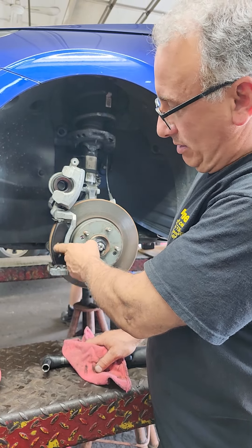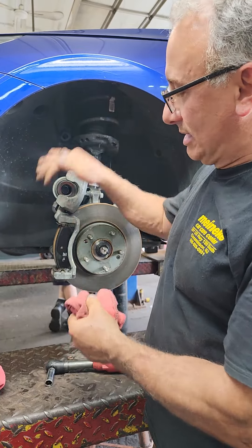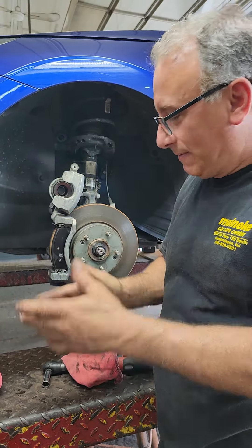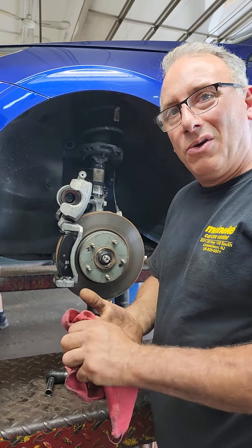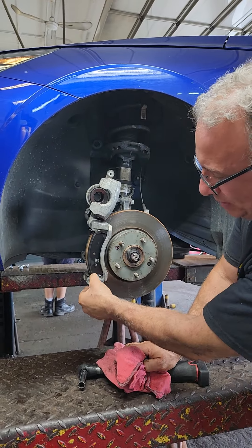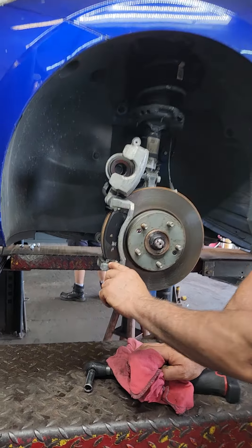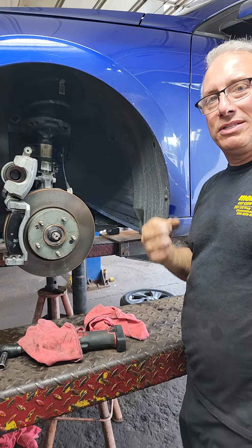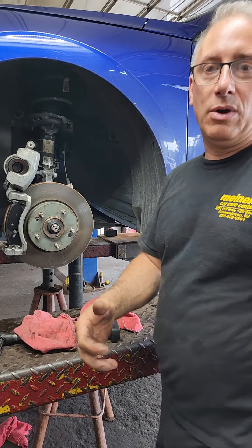What we're going to do is brake-clean all the lubricant off the caliper, then take black RTV and put it on both sides. Set the caliper down and in about 10 minutes it's going to start to get sticky and hold those pads in place so they don't click anymore. We don't use Perfect Stop brake pads here. Somebody was definitely in over their head. These pads have weird little tabs that lock them in — you see that? What I do is just bend the tab down, get the pads in and out, then bend it back up. We don't really need any parts to fix this — just skill, ability, and experience. Thanks for watching.